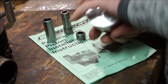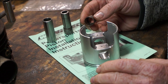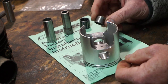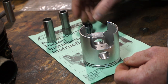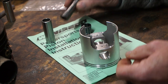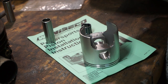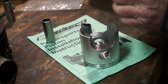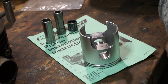These caps — I actually make them out of needle roller bearings. You get a needle roller bearing cage, cut one side off, take the needle rollers out, and you end up with an 18mm cap that will step up your 16mm pin. Some people have them machined, but I find that's the easiest way. Just order a needle roller bearing cage that's 18mm outside diameter — the inside is 16mm — trim off the end, drop the needles out, and you've got yourself a nice cap for your piston.